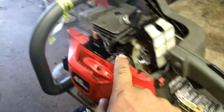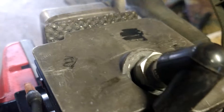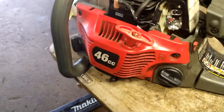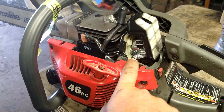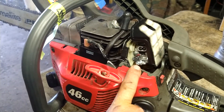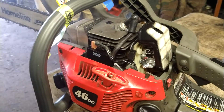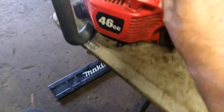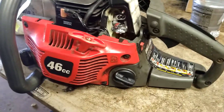This is more of an idle screw. It was smoking — it had some serious oil build-up in it, sizzling off. This guy had a lot of oil going on for some reason. But it's running perfect now. This is your fine tune for your idle, so you can bring this down a little bit more. I got it pretty much where I think it should be. This guy should be pretty happy. And like I said, you can do it all through this cover — you don't have to remove it. Usually there's a little rubber boot there; this one was missing.